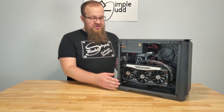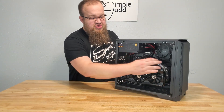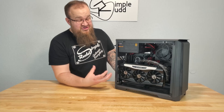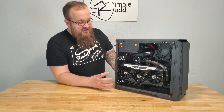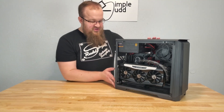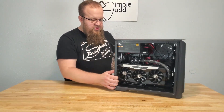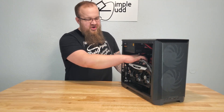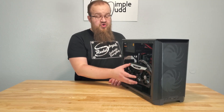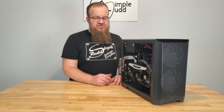That brought in its own challenge. With the Arctic AIO, everything comes straight out, so it kind of pushes on the graphics card. This is a big graphics card — a 3070 Ti, basically a triple slot. They call it two and three quarter, but the shroud sticks out to your third slot so it takes up a lot of room. It also comes close to where the lines are coming off of the AIO processor, which made that difficult. I would still recommend if you're going vertical to put the graphics card in last — in fact, even horizontal I think I would still run that last.